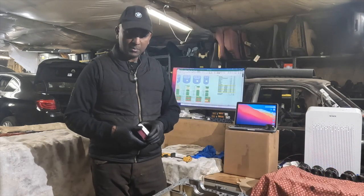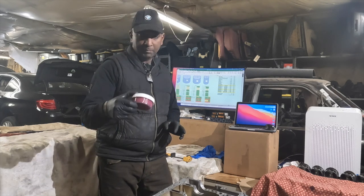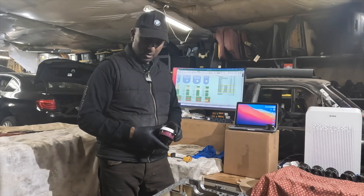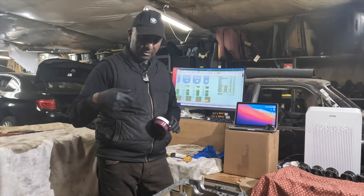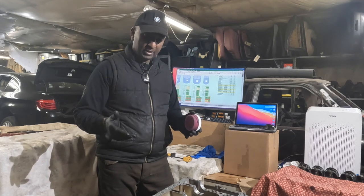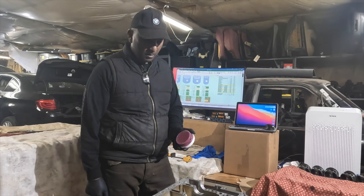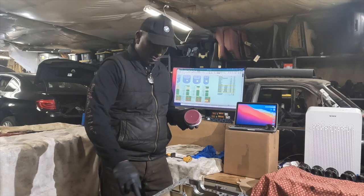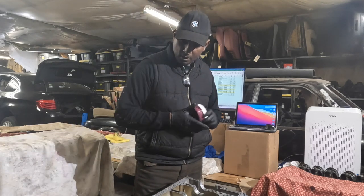Next thing that we want to do is install the crankshaft with our assembly lube. I'm using Redline assembly lube. Install the crankshaft, check the axial end clearance or end play, then check the rolling coefficient of friction. I usually check it with the bed plate off and with the bed plate on. After that, we are going to install the lower bed plate with the sealant. Okay, so let's get to it.